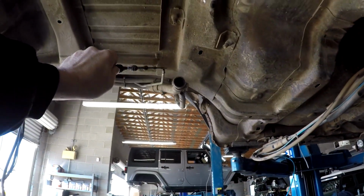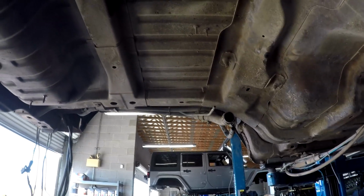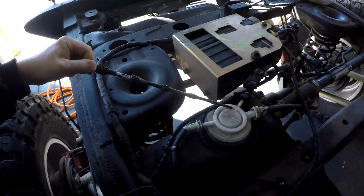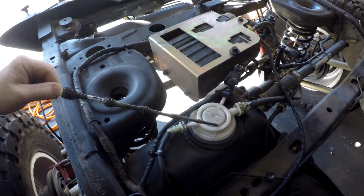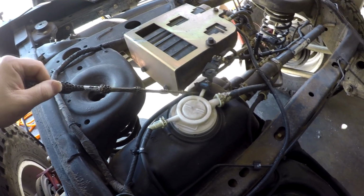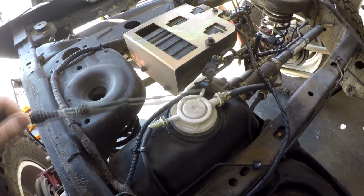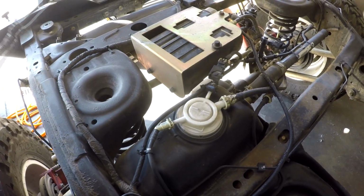This is our fill tube, and that's our fuel inlet breather, which, as we discussed, controls the fill valve inside of here. Now, if this breaks and you can fix it, that's great. But if this gets damaged, we've seen these melted and other problems, you're pretty much screwed.